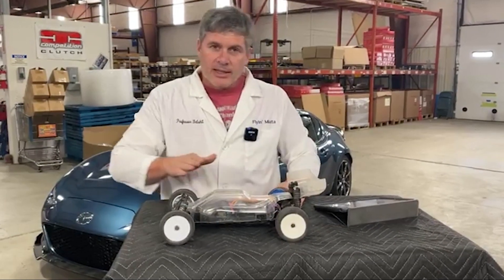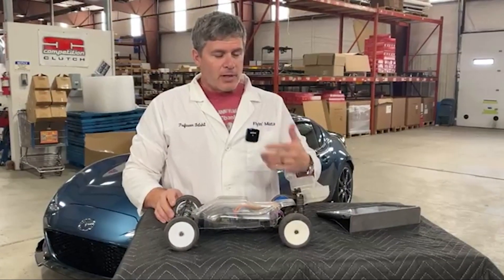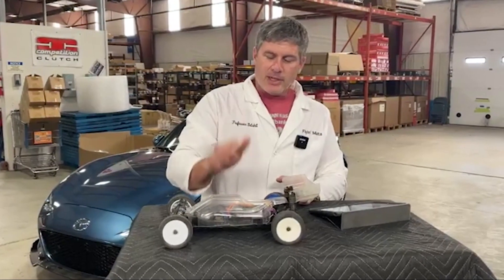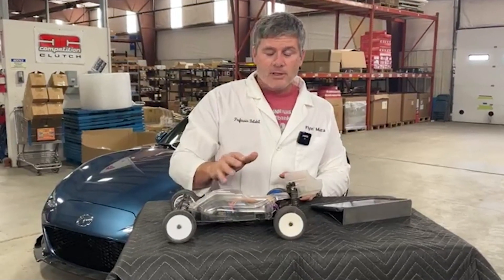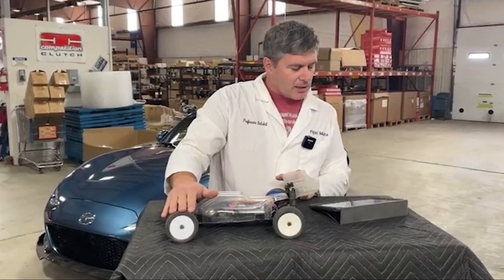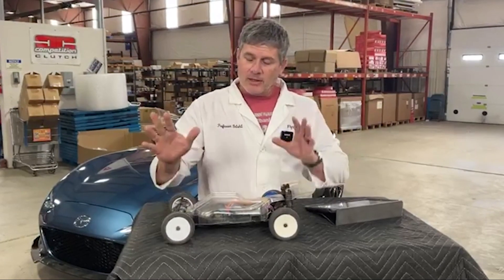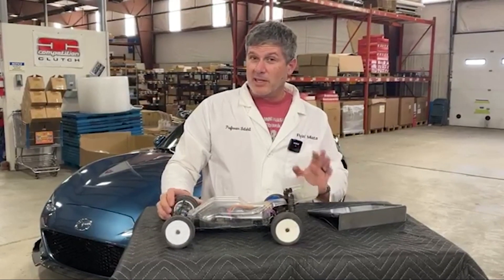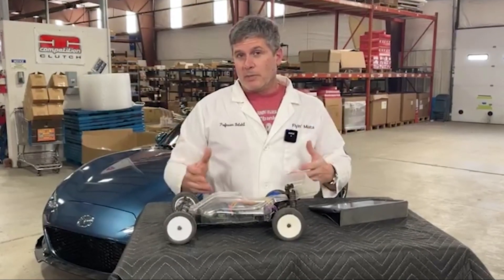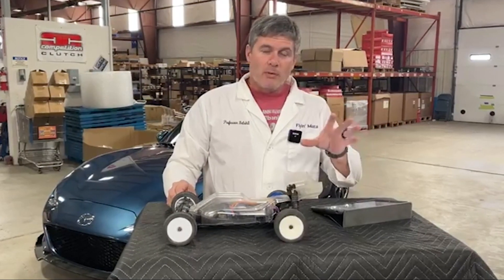I think there's a small torque distribution effect — dragging the inside wheel pushes more torque to the outside, helping drive the car around the corner. Effectively, it makes the car feel better in fast corners, with more stability and linear steering response on turn-in to apex, and more stability on corner exit. Dave's comment was that the Miata's always been good at tighter corners; this gives it more ability in the faster sweepers where it's always been a little weaker.